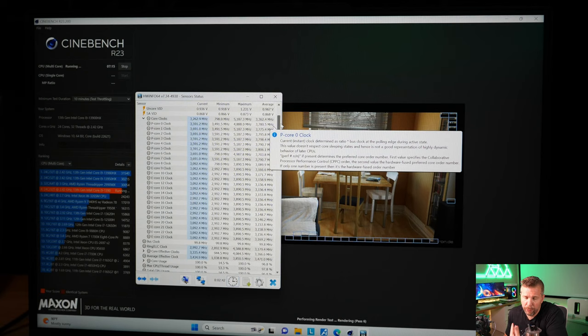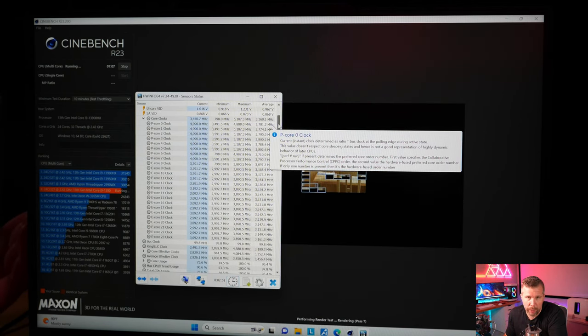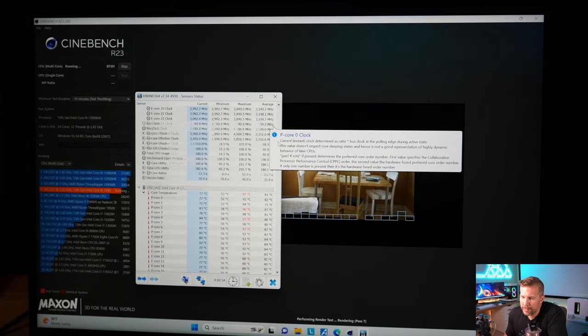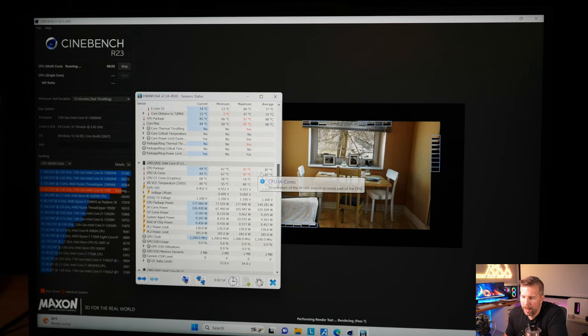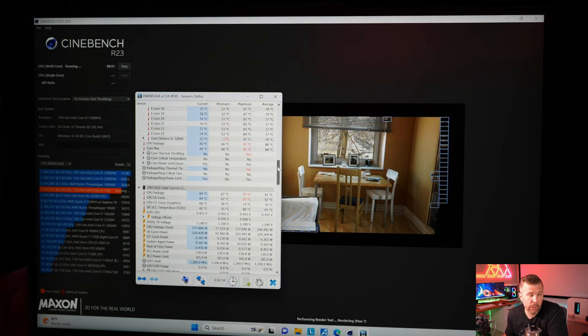Now, since it's, I believe, an unlocked CPU, Lenovo lets you tweak it with Intel XTU and other control software like Throttle Stop. That's going to let us undervolt this thing, raise the long power limits. It'll let us push the performance of the CPU up to maximum and really give us the ultimate level of performance control that advanced users will love to see.